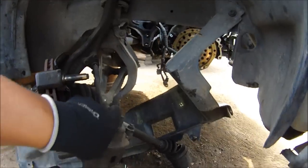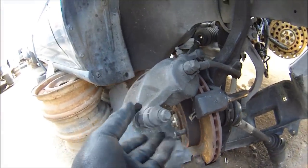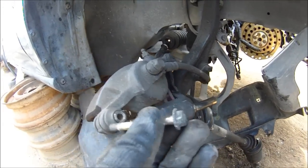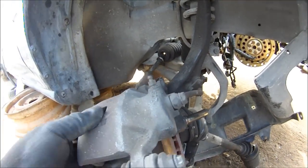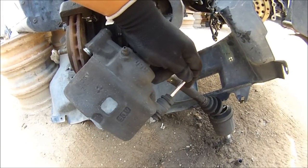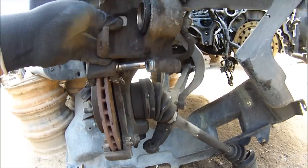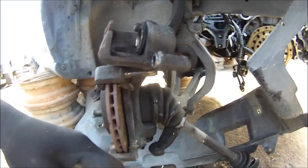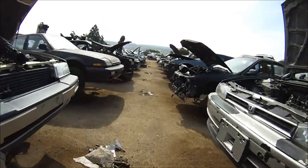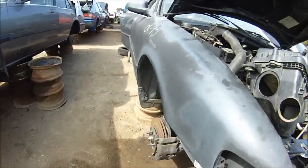Another Civic here. Looks like somebody took these apart already. But that's all it is - just taking off this bolt right here. That's a 12mm bolt. Just goes on this caliper like that. Pop off that bolt right there, slide it up like this, and it'll expose the pads. What we're looking for is some good pads - nice new ones, thick ones. They don't got to be brand new, as long as they look fairly thick.